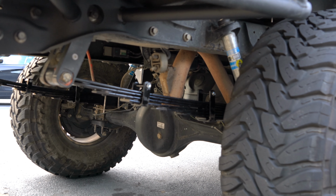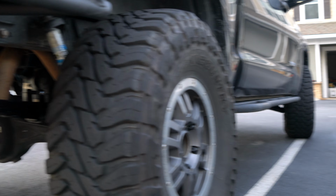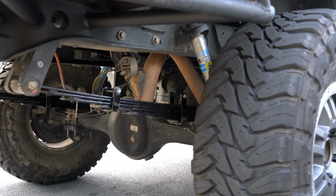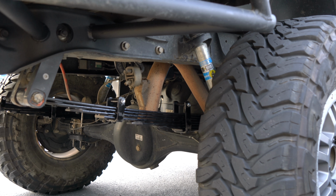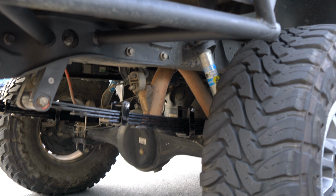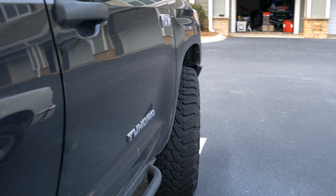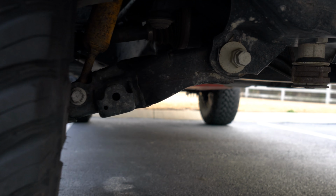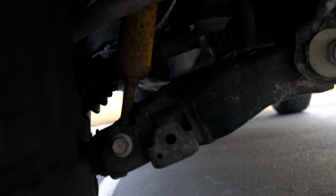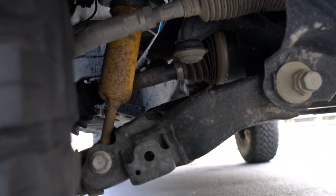So I have it parked with the front facing out, because tomorrow morning I'll be ripping apart the front CV axles. The outer CV boots were both ripped on both sides, splattering grease. Drove about 20,000 miles on them. And since I was going to replace the fronts with the 2.5 coilovers by King with reservoirs and adjusters, I thought I'd go ahead. I don't know if it's a little dark, but everything in here is black, just splattered everywhere.